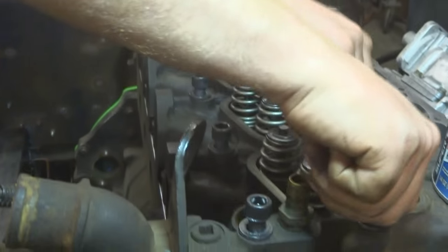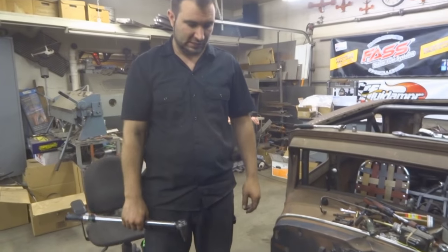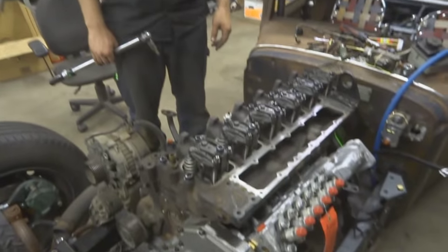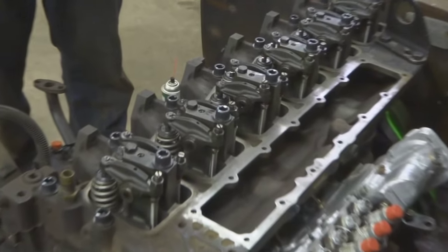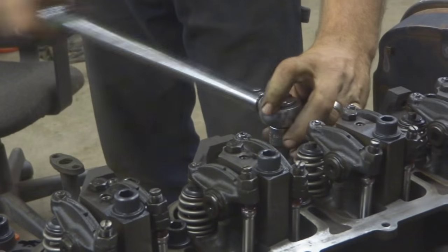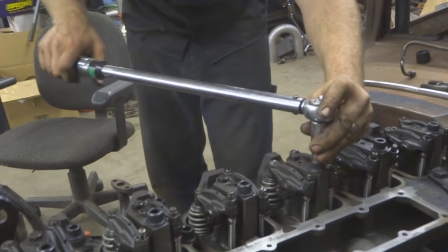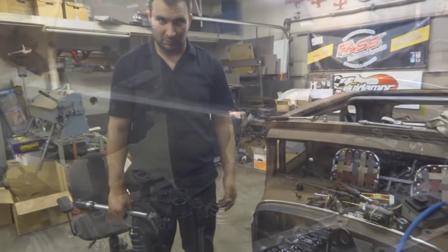This is just a more accurate way of doing it with bolts, simply because you've got all the torsional loss of actually twisting the bolt to get the threads to turn. That's the one benefit of a stud. You don't have to actually twist the fastener, you're only twisting the nut. Right. So you don't get a bunch of twisting load. Okay. Less likely to break them, things like that.